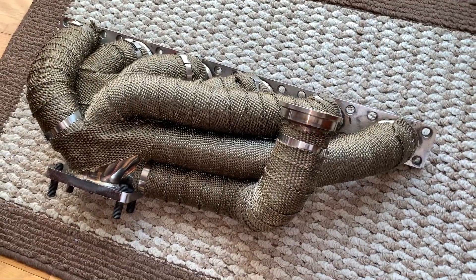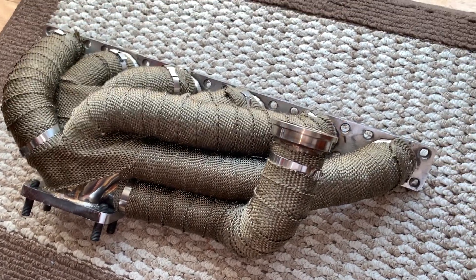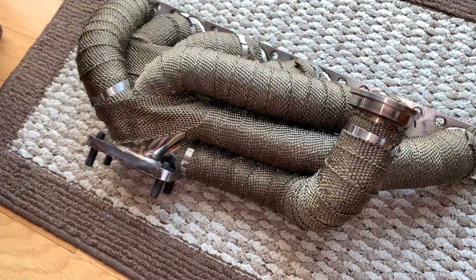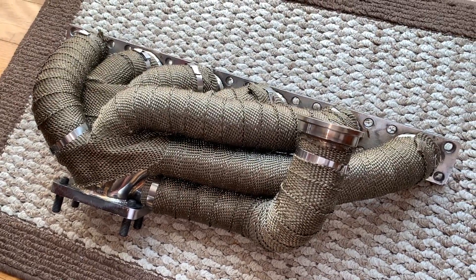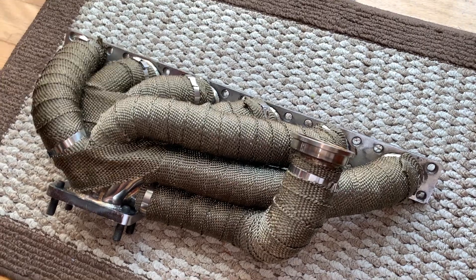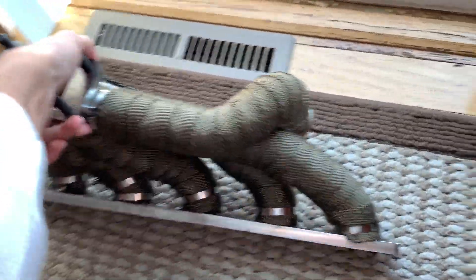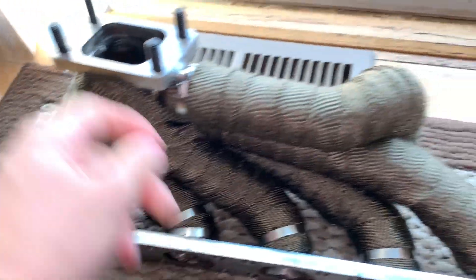It's a good thing for like exhaust downpipes and stuff, but not for manifolds, because manifolds get a lot hotter than the actual downpipe. If you let the header bake in itself and get way too hot - which is basically what this heat wrap does - the turbo manifold won't last very long. It will corrode, get a lot weaker, and crack. People say that at around a thousand miles it starts messing their manifolds up.